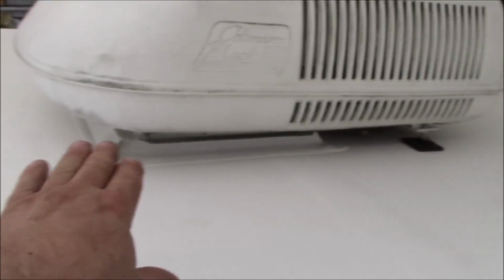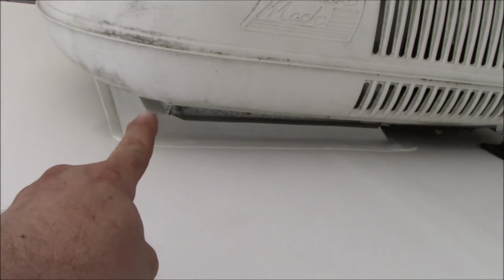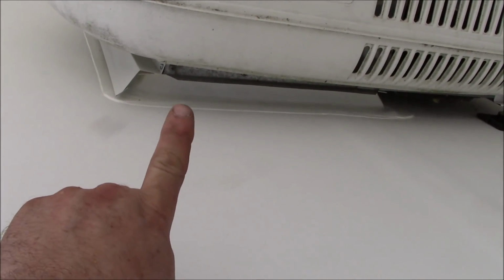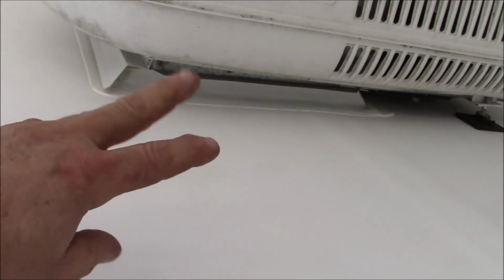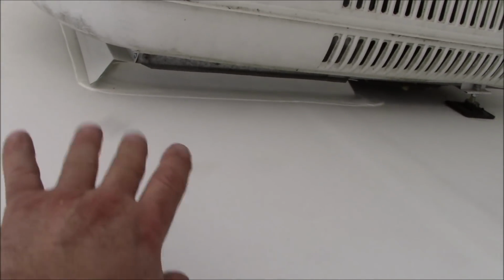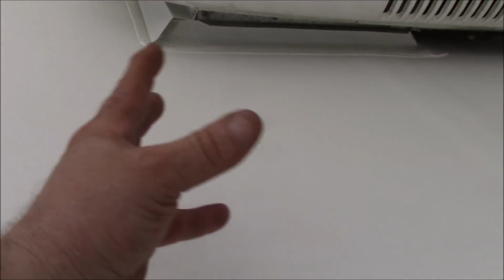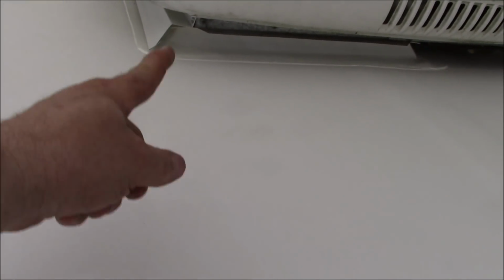So now, in the front of the AC, we've got the same curb design as all these other ones. Now the water is going to keep running down here, and as it does, I don't want the water to trickle in the front here and get into that foam gasket. There's a foam gasket up inside there. So the way this bottom is designed, there's a lot of extrusion, if you will, so when water does hit that, it'll roll out, it'll have trouble trying to get back there. But in the front, I didn't want it to hit there and then just take all that brunt of the storm or the water or anything that's coming in. I didn't want it to come in at it at all, or when it runs down the cap.